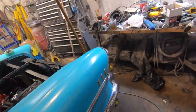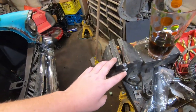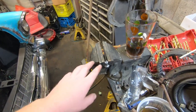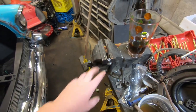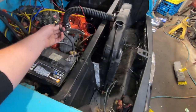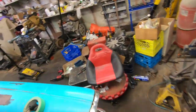The headlights were all working - that's where I left it with you guys last time. I did hook up the turn signal and park lights. This is actually a switch I think it's off a Nova I had. The rod wasn't long enough so I ended up welding a little bolt to it and I just JB welded it - so that's gonna sit and set up. I'm too cheap to buy another one. The headlights will be on when I hook this up.